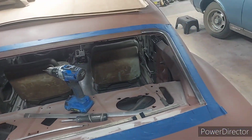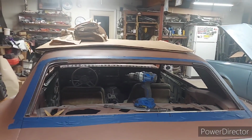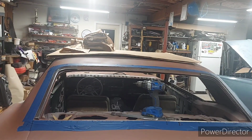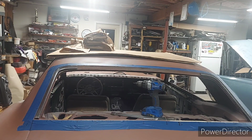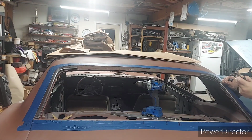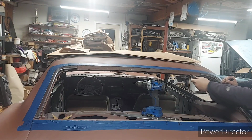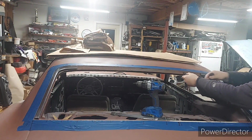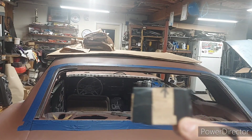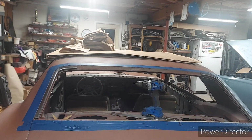Okay. Yep. And that's the way you guys have to follow, and you could do the same. I don't want to do the whole thing because it's going to take too long of a video. But, of course, you repeat the process, just like I showed you guys. You mark your locations with the shim. Okay. The one I'm using is 3/16 of an inch, like I showed you guys in the gauge. Right here, there's a black line. So I will be marking it. You mark it with the shim. You put the marker, put your dot, drill, put the screw, put your clip in, and all done.